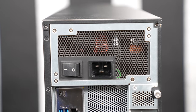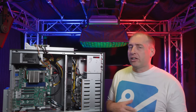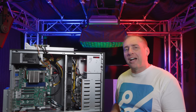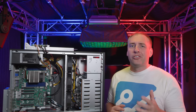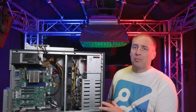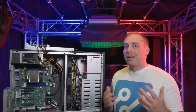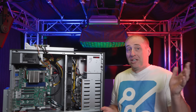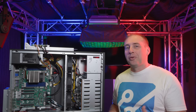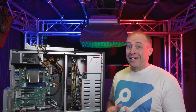Just a note on this power supply: it is a two-kilowatt unit at around 200V or higher. But if you're at 120V, it'll be a 1.5-kilowatt supply, and if you're down in the 110–115V range, you're looking at more like a 1.2-kilowatt power supply. That's important because if you load this up with a bunch of accelerators, high-power GPUs, CPUs, and all that, the 1.2-kilowatt rating is probably not going to be enough. So you probably won't want to run a fully loaded system on lower voltage circuits.